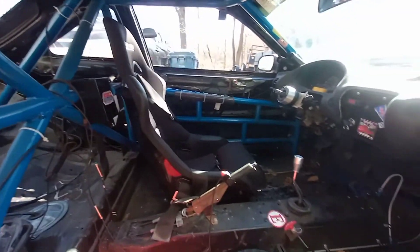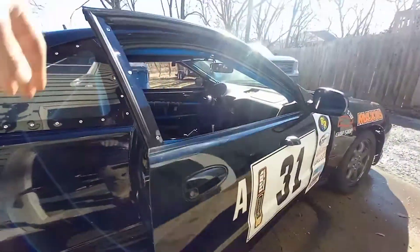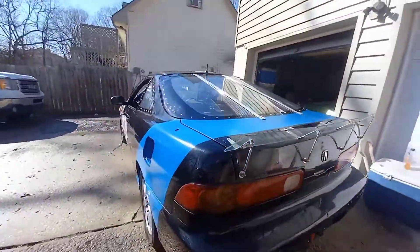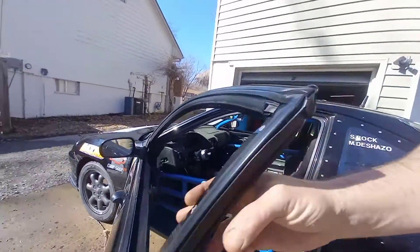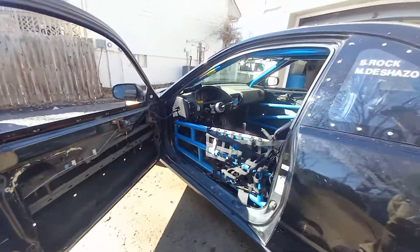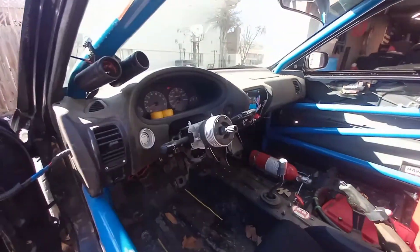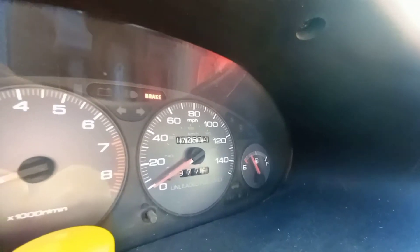After blowing up the Type R motor, I took most of the hard-to-find stuff off and put back on stuff you can easily find at parts stores down the street. Realizing endurance racing is about the ability to keep your car running — so unless you've got deep pockets to have two or three of everything, ignition systems, ignition boxes, I went the smarter route. Two shift lights: one for 6,000 and one for 7,200 RPM. Both shift lights are out so you know when to downshift — helps rookie drivers know when they can downshift without popping a motor.